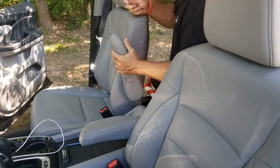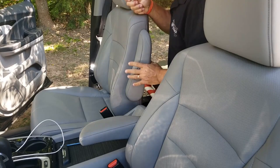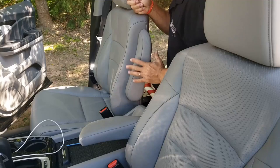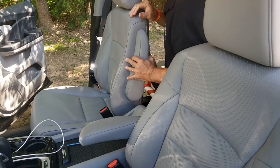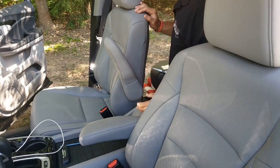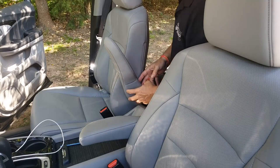I'm trying to replace these ratcheting factory armrests with some aftermarket armrests that are wider and give you a little bit better support. According to Honda, you're supposed to be able to put these ratcheting armrests at about 37 degrees, which is somewhere in this area here, and they should just pop off — there's a called a sweet spot in there.